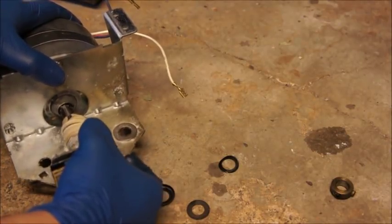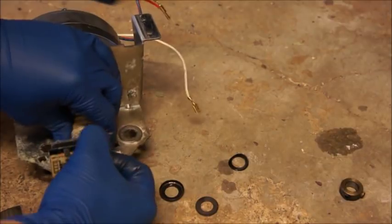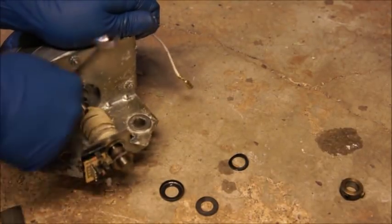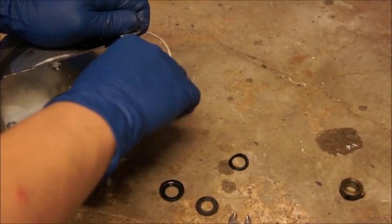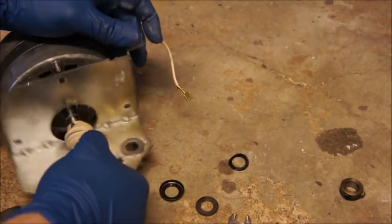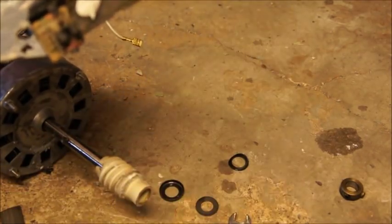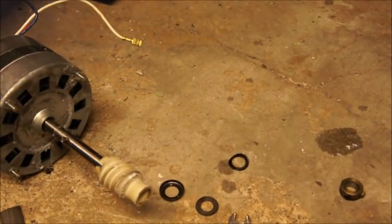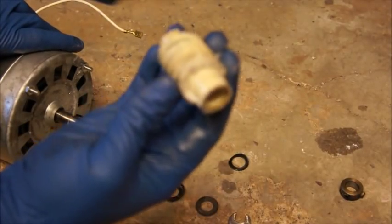If you can grab it, take your motor bearing and pull it off. If it won't come off all the way, go ahead and remove the motor plate using your 3/8 wrench — there are three nuts that hold the plate to the motor. Remove those and the motor plate comes loose. With a little bit of pressure, the motor plate comes out along with the old bearing. And the old gear comes off. Chuck that in the garbage so you don't confuse it with the new one.